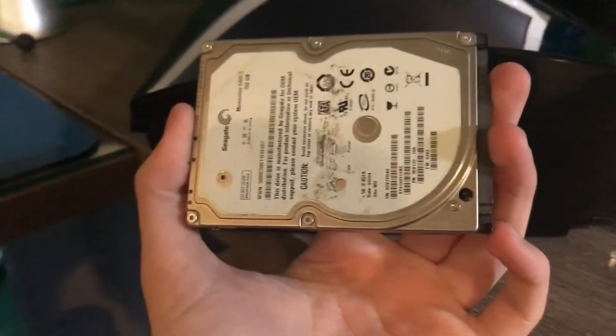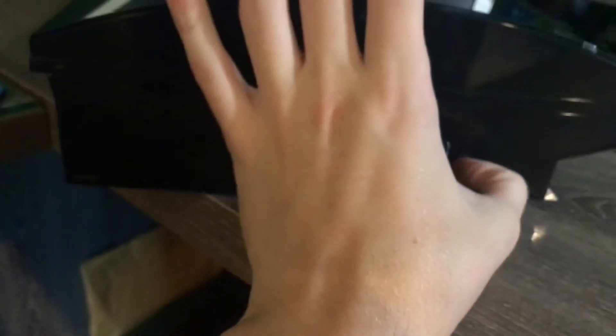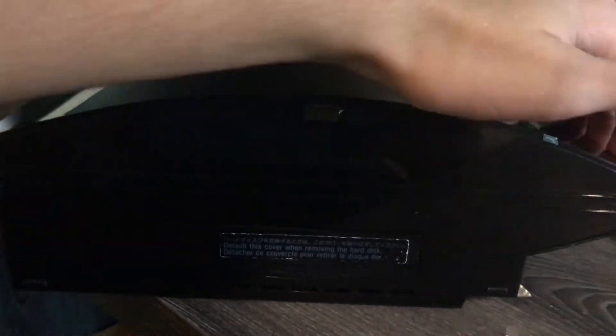Keep in mind: if you do this, make sure to back up any data before doing so. Use the backup utility in the operating system to a spare drive or even a thumb drive if you have one large enough for all your data. Once you get the new drive up and running, you're going to need a USB flash drive — you don't need a very large one — to install the system firmware, as the update file is not that large.